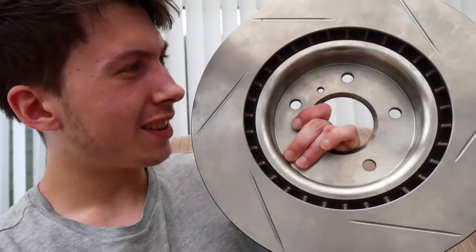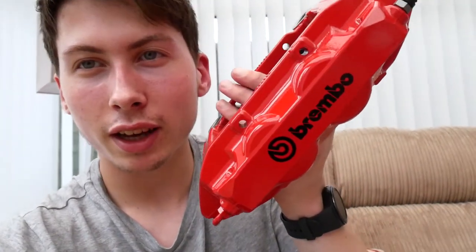That's like one disc — it's like the size of my head! But yeah, that's a disc. I'll put a link in the description for the actual kit itself, so if you want this after this video you can look it up and see where to buy it from. And finally, the caliper is a bit lighter than the disc. The entire kit — caliper, pads, bracket and disc — weighs about half a kilogram lighter than stock. Bear in mind these are a lot bigger, so you get better brakes and weight reduction in terms of unsprung weight.